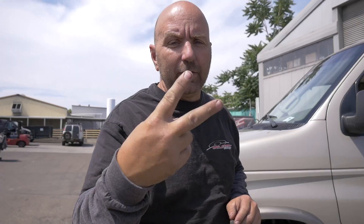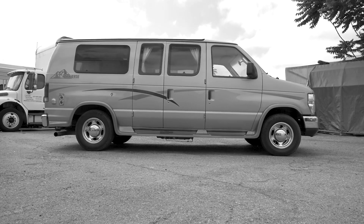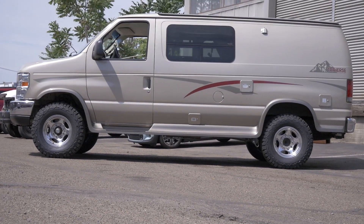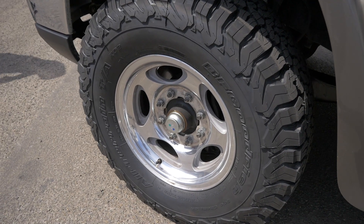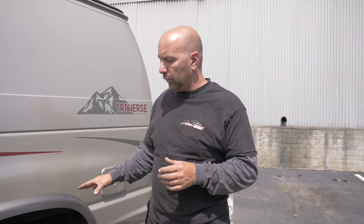What's up guys? Alright, this is day two and now we have this Traverse done. You're going to get a chance to see some before — how we started this before we did anything to it — and now after. This thing is looking awesome with a set of BFG KO2s. On this we're running a 265/75/16, so we stayed with the 16-inch wheel and just went with a bigger tire using the stock wheels. We also did the full custom leaf springs in the rear, which was one of the big things we wanted to show you — doing a full custom set of leafs, not just add-a-leafs, with this four-inch kit.